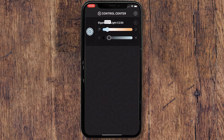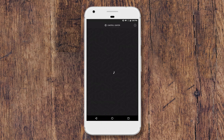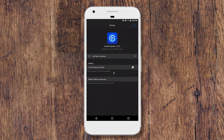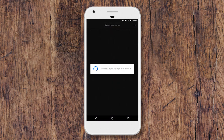The last method to connect Keylight to your network is via your Android device. Make sure your Android device is connected to your 2.4GHz network, then download and install the Control Center app from the Play Store. In the app, tap the Settings icon, then tap Add Accessory, choose the Keylight you want to add, follow the additional prompts, and you're all set.